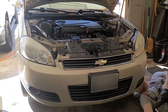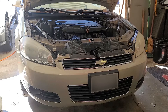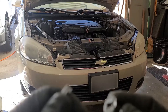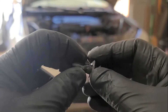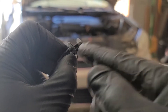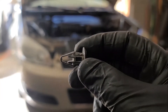Now we do the same thing on the other side. Worst thing about working underneath the car - stuff falls on your face. I do have safety glasses, but like an idiot. So this is all of your hardware underneath. The clips: this goes into the hole and then this little peg goes into this. As it presses in it spreads the end and it holds the panel in place. To get them out they all get pushed together - you've got to get your tool under this and pry up on it. That can be a challenge because these are underneath the car so they get little bits of dirt stuck in this area. I do keep a small stock of miscellaneous clips so I can replace these if I break them.